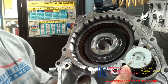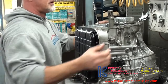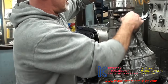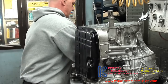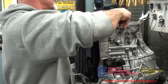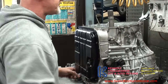Cool return filter. Here's the clutch pack — I believe this is reverse. And I believe this is forward. There is a specific way you want to put that back together; I'll show you that later. There are also two seals — make sure you put those back in. The two little seals are the same. Just want to make sure you've got them before you pull it apart.